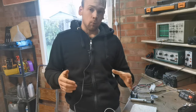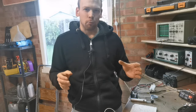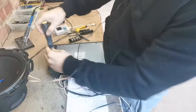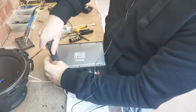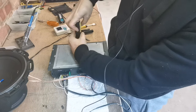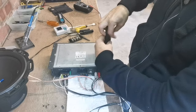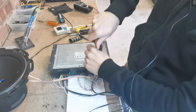There is a third way, which is essentially the same approach but for if you cannot get your head unit out of your dash and your amps are on show and you want to be a bit fancy — you don't want to show people that something's broken. This third way involves opening up your amplifier and I do not recommend you do this unless you're fairly confident with electronics. The first thing you want to do before opening an amplifier is disconnect it fully from the power supply, then wait — probably the best part of ten minutes — because your amp is going to have rail voltage in it and that takes a long time to sink away, especially if your amp is in the four or five thousand watt range.